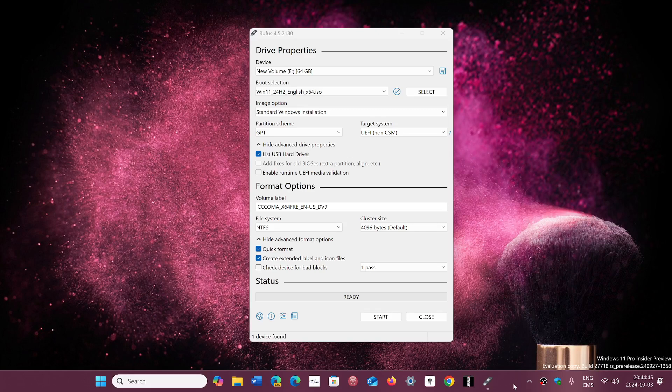Where it'll get a little complicated — and that's where we're not sure — is when we get to 25H2, because Microsoft is really thinking about blocking all of these loopholes. So if you're using Rufus, you download the image for the Windows install from the Microsoft website. You can see here Windows 11 24H2 English x64.